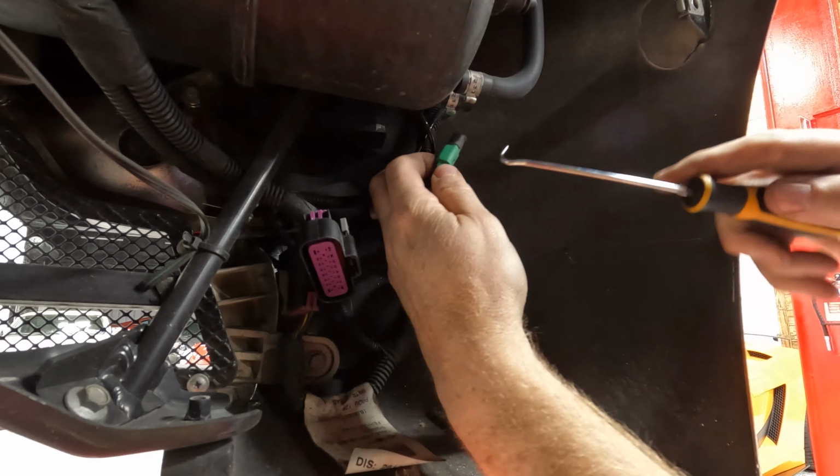So all this heat shield and stuff. There. Yeah, jeez. Okay. These tubes go directly in front of the easy access. I'm gonna have to do these from below. So you gotta kinda push the header up in order to get these ones in here and use a super long extension. And the hardest part is you just can't see.